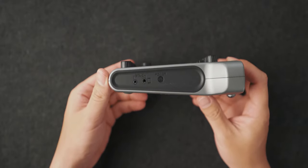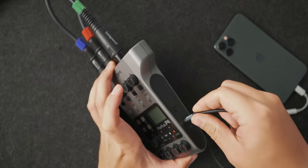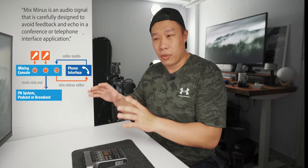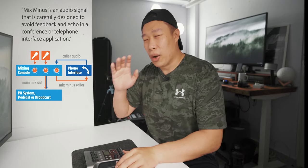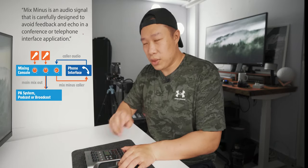There's also a 3.5mm TRRS jack port on the side for connecting your phone, letting people call in and be part of your podcast. The device has a feature called Mix Minus. In simple terms, when a caller is looped through a mixer or recorder, they normally hear their own voice back in a weird feedback loop. Mix Minus automatically cuts off the caller's own voice from being repeated back to them, while everyone else can still hear each other normally. It's an automatic feature you don't have to worry about — a really good one.